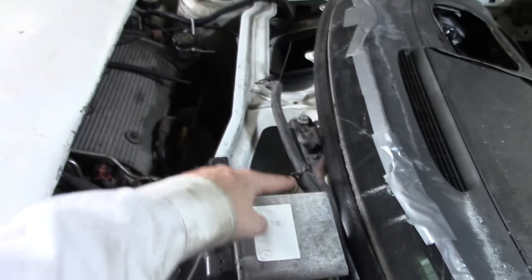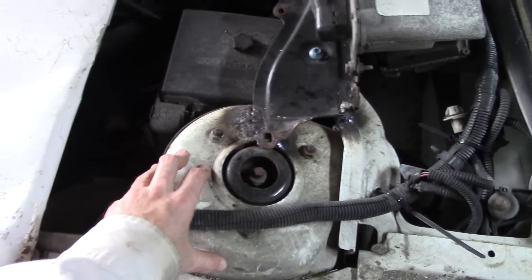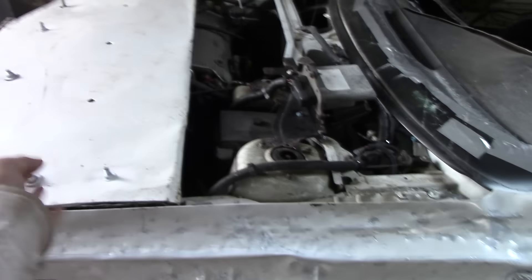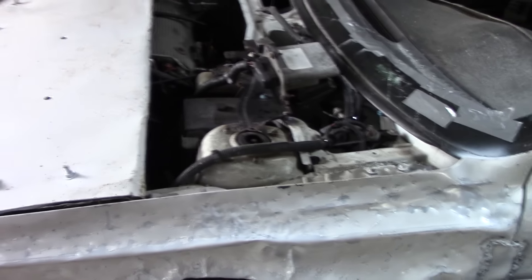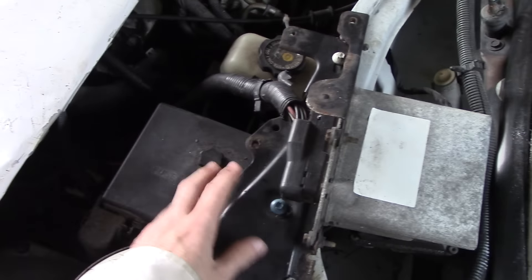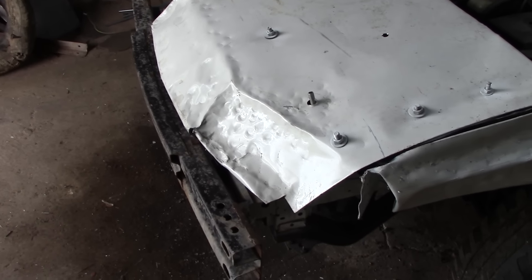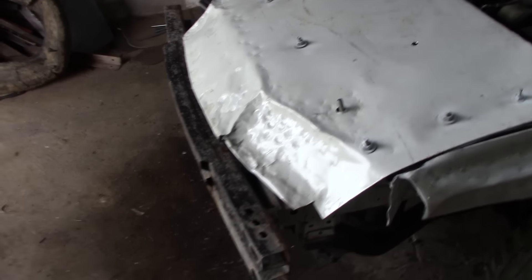With the ABS unplugged, I was able to extend my wires, get the whole harness up here out of the way, and mount my computer nice and safe. Here's another part of the harness coming up into the firewall — it runs right next to the strut. Probably the safest spot under the hood of a front-wheel-drive car is your strut tower; anything you can attach to your strut tower, go ahead and do that. I've never seen one of them get destroyed unless a car ramps on top of you. That will be a weakness to this car since the hood slid forward — if somebody comes on top of me their wheel could potentially fall down in this hole. I moved the hood forward because I have wiring coming out right here that it would pinch, and my computer is now in the way so the hood would not close.